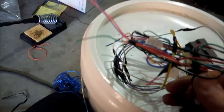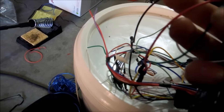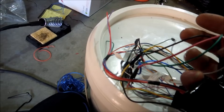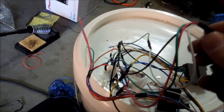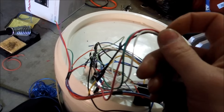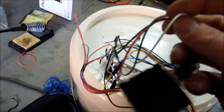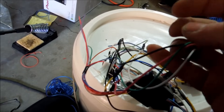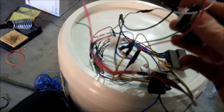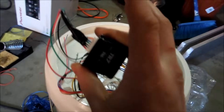Red goes to red, black goes to black, yellow goes to yellow. TR7 is really easy — white wire goes to parking brake, green wire goes to the blue-white wire which is the remote, the red wire will go to red, and the black will go to black. Now, if you have an Alpine radio, I can't tell you the colors off the top of my head. I know there's a yellow-black wire and a yellow-blue — I believe the yellow-blue is the parking brake wire, but you'll want to double-check that. The blue wire on here, if I had it pulled through for an Alpine unit, it would go to the foot pedal. If you had a TR7, you would just hook the foot brake up to the blue wire and it would bypass the foot brake as well.